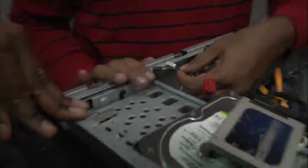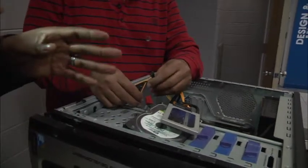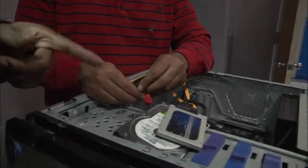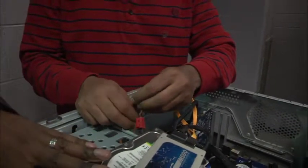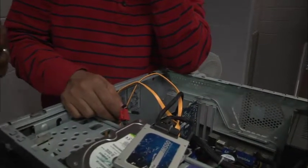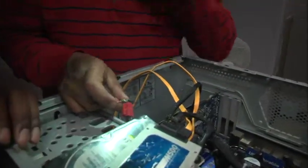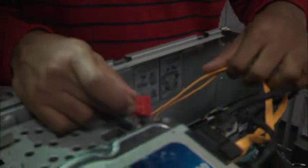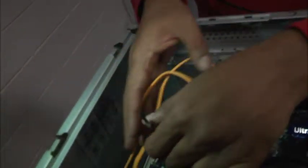That's going to connect the case to the motherboard so that when my hard drives are thinking and spinning, you'll see a little yellow, amber, or red light on the case that will intermittently blink to let you know your hard drive is spinning, it's thinking about something. So the whole idea is to look for that black sleeve there on the motherboard. That's called my front panel connector. This one right here? Yes, that one right there.